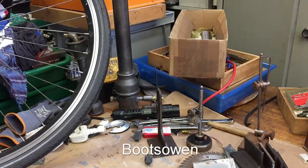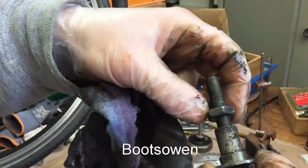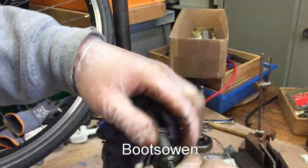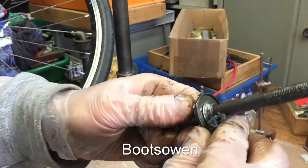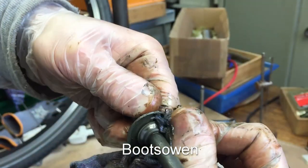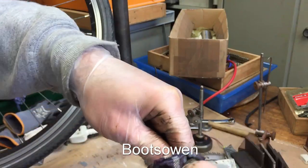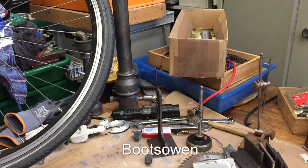This is a cheap old wheel - it's a B-Twin bike, which is not famous. But that looks pretty good on that side. The grease was a bit of a different colour, but it looks pretty good. Compared to some of the bikes I've taken asunder and put back together over the years, it looks pretty good. I'm pretty happy with that. I think we can save that wheel, which is great. I really hate throwing stuff like this out. So let's just get that lock nut back on there and tighten it up where it was. Oh, bollocks - that side is crap. I'll need a new cone on it. Hopefully I've got an axle that'll do it. It's great that the cups didn't take it and the cones did, because it's far easier - you can pull the cups out but pressing in new ones is not a job anyone would bother with.